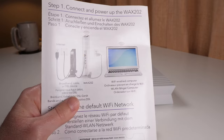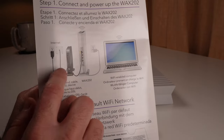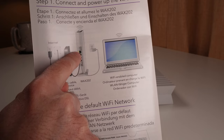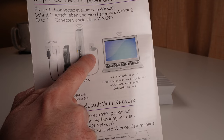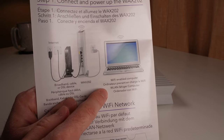If you need a diagram, you'll probably get one with your manual. As I mentioned before, they take a modem and put it into the WAN port — the yellow WAN-labeled port — and then make sure to power the router. You'll need a computer at this point.